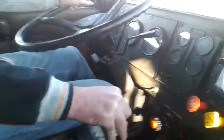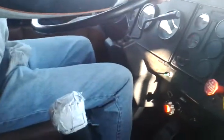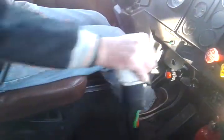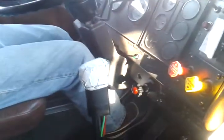Okay, go ahead, shift — one, two. Alright, we're in fourth gear. Let's step on the clutch and we'll stop the truck. Smooth and gentle on the brake. We'll stop with the stick in first gear — up in neutral, and then straight forward to be first. There you go — foot off the brake, and your clutch, engage it properly. Very good.